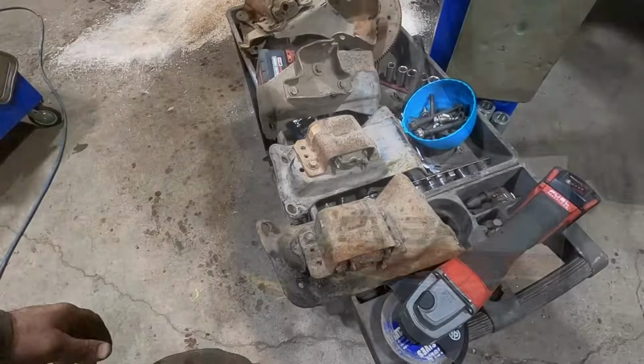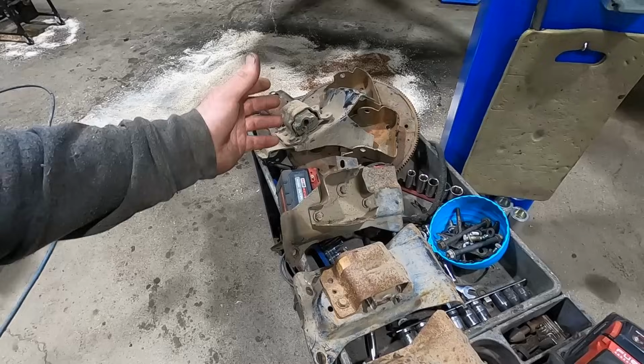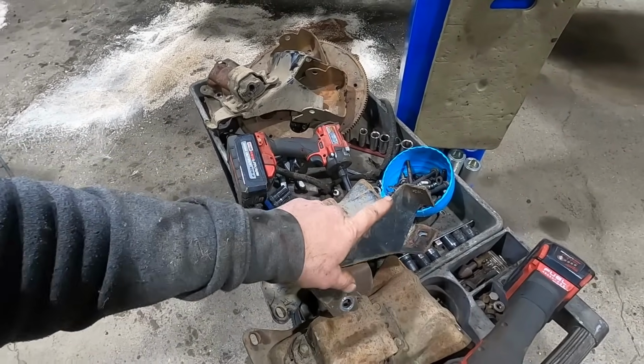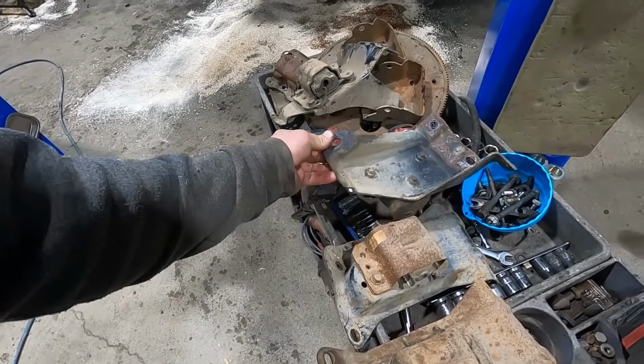Ford things. So here's our engine mount stand tower thingy. And I know somebody's gonna argue and say, just slide them ahead. But you can see these have this shoulder that comes off that's significantly different. And then instead of having two bolts at the bottom, these guys only have one. And absolutely, we could have cut these up and modified them and re-drilled holes and spent a whole bunch of messing around, where it took me maybe 20 minutes to get these other ones off. They're cheap, they're plentiful. We're just gonna grab them.